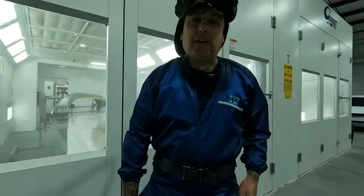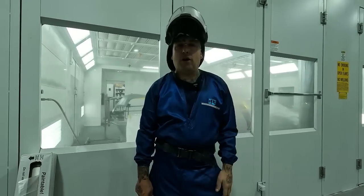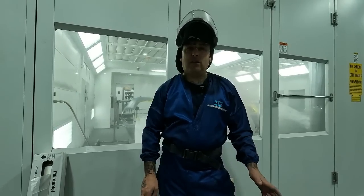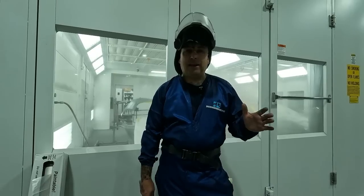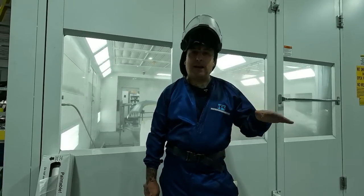All right, so that's the sealer. We used the epoxy, the DP on the hood for the bare aluminum, and then we went into our normal ECS sealer for the body of that. So that's how I handle them. I like the way the ECS lays down a little bit better than the epoxy, but being that's a flat hood, you're not gonna have any problem with it.